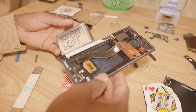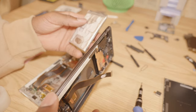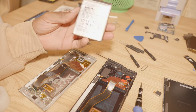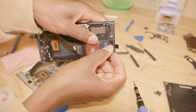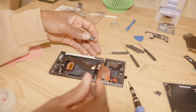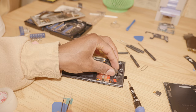All right, so we're going to go ahead and transfer everything into the new screen. I would suggest you order a frame that comes with the battery pre-installed so you can just get rid of the old battery, but if you want to take a chance you can do that — you just have to be really careful when removing the battery. It's tricky. Front facing camera goes in at an angle. The front speaker — we also have a couple of films that we have to remove from the new screen. Speaker goes right here.